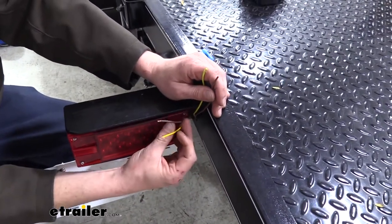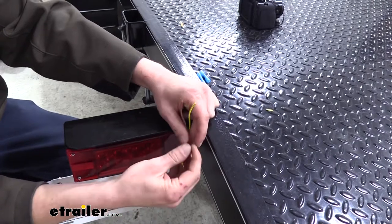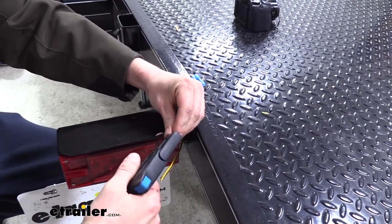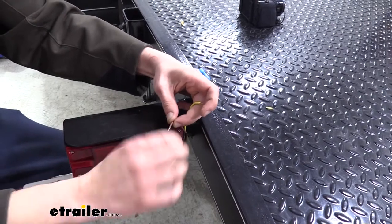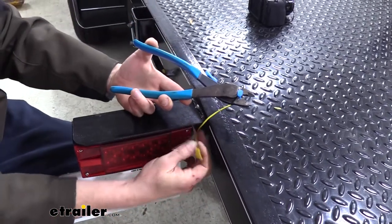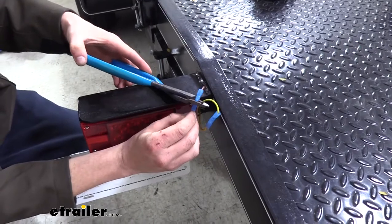For our remaining wires, we're going to connect those to our trailer. One of the things I like about this light in comparison to others is the color code they chose for their wiring, because typical trailer lights are going to have yellow for the left turn and brown for tail lights — and that's what we've got run on our trailer, so our wire colors are going to match up. We'll strip those back and connect them using heat shrink butt connectors. Since this is exposed on the outside of the vehicle, the heat shrink will seal it up, preventing moisture from entering in, preventing corrosion, and ensuring a long-lasting connection. We'll start by hooking up our stop/turn, connect it to our trailer side, and then connect it to our light's stop/turn circuit. We'll then do the same thing to connect our tail light circuit.